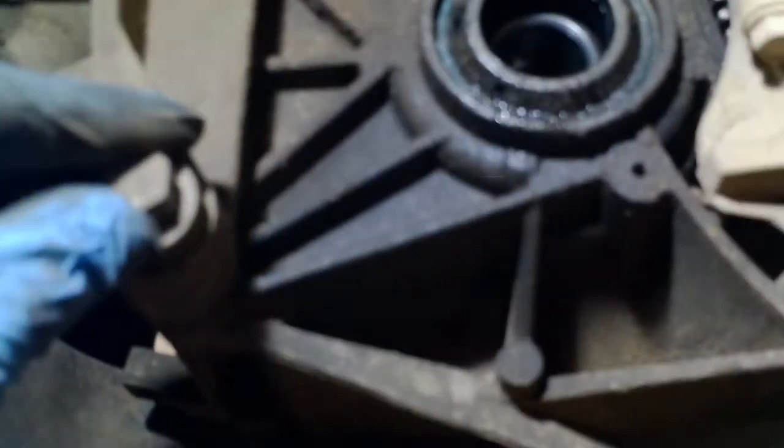I've loosened the engine-to-transmission bolts. There's one up here just below the water pump cable — you can't really see it, but right above this bracket there's one you don't notice right away, then another one following it down. I also have the engine or transmission mount bolts loose here and here — there's three in there. This whole thing can come out; I remember I had the transmission out once before when I put a new clutch in. Here's the front engine mount — I took that bolt loose as well as the two that hold it to the transmission. There might be one more on top.